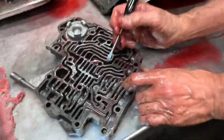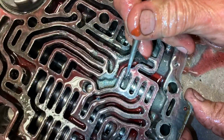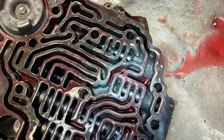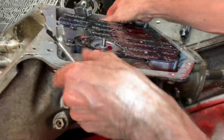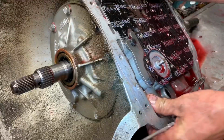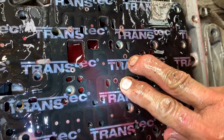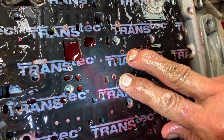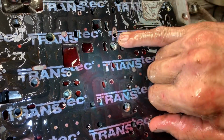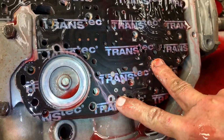But you modify it identically to your standard 350. You come in here and weld this valve right here. You take it where it doesn't move. Okay? You come in here and you drill these two holes out bigger, 130, 140 thousandths, big enough. You leave this check ball out. You leave this check ball out. You put these two back in.